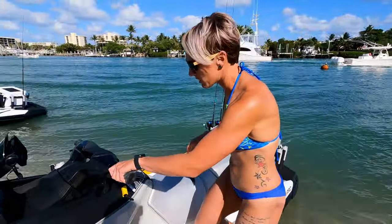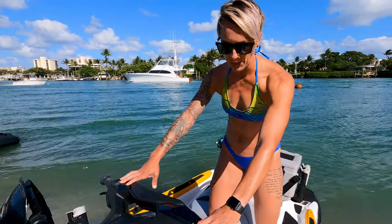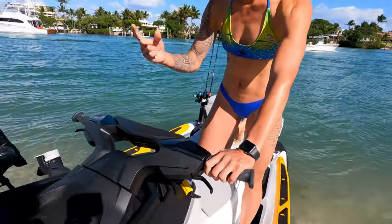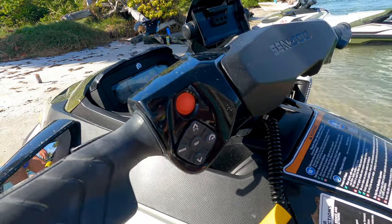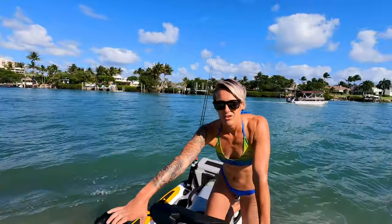One of the new things on the 2021 is the IDF system. Basically, if you go through weeds, rocks, or anything like that, you don't want that sucked up into the engine. The engine is actually going to be able to release that stuff with this IDF button. All you have to do is press this IDF button, then squeeze the brake lever and maintain it engaged, then squeeze the throttle with IDF engaged - and it will release all of that stuff from your intake system.